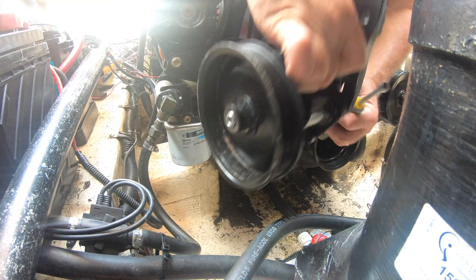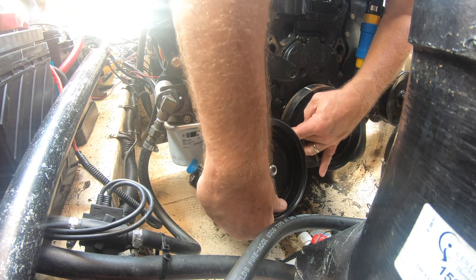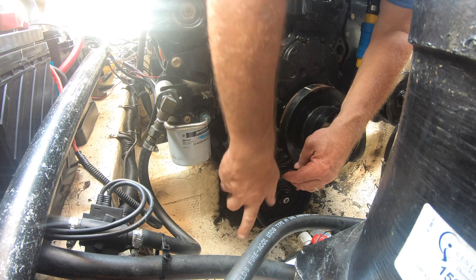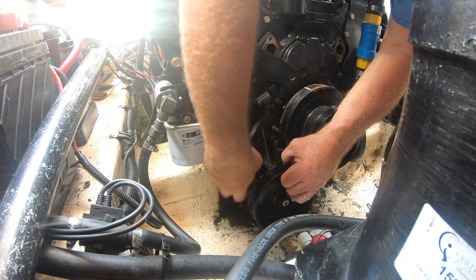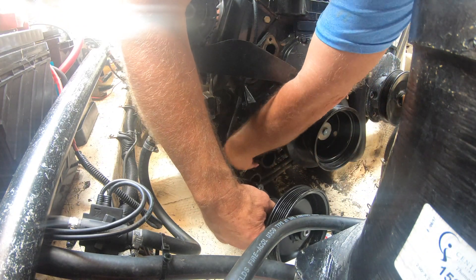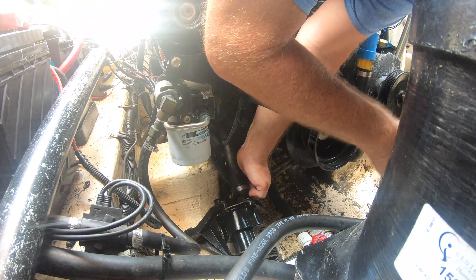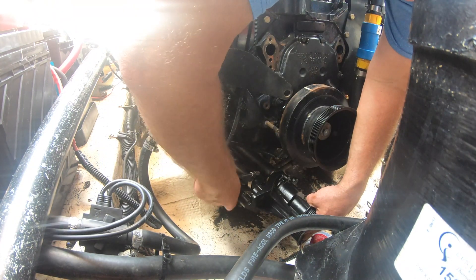Now the fun part — putting everything back together. You'll see that there's a larger and a smaller diameter hose and fitting that corresponds to it. While it seems like the easier way is to just hang the water pump on the bolt and then connect the hoses, it's actually easier to connect the hoses first and then install the water pump. You do have to kind of twist it to get it on. The mistake I made was tightening up the hoses first — you need to leave them a little loose so when they get into place they're oriented correctly, then you tighten them up. When you tighten the clamps all the way and then twist the water pump to install it, it kinked the hose and restricted the water flow, so I loosened it, realigned it, and re-tightened it.